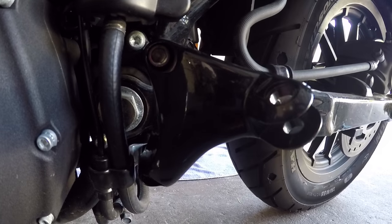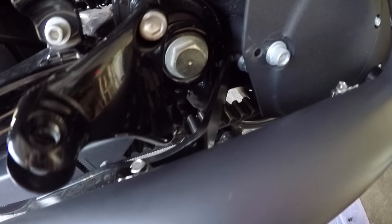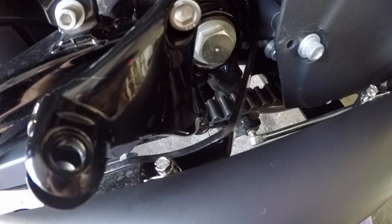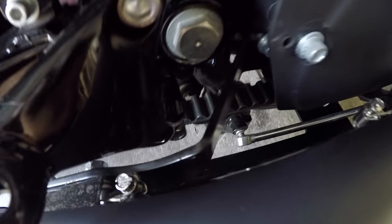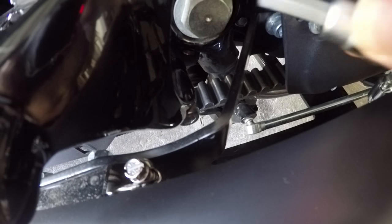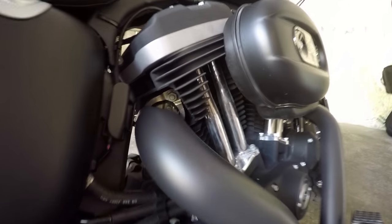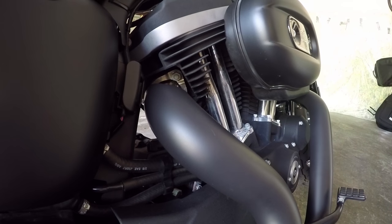All right, let's get to the right side. I've put the bracket on to see if we could have any clearance at all, trying to get that bolt tightened up, but with that little clearance that ain't gonna work unfortunately. So we're gonna have to loosen the exhaust at the flanges, which requires a half-inch socket with an extension so you can get in there and get to that bottom one as well.